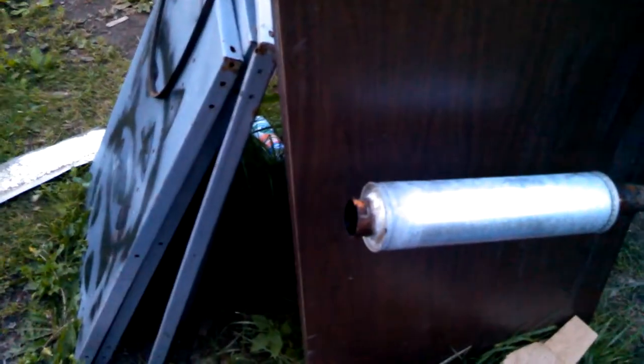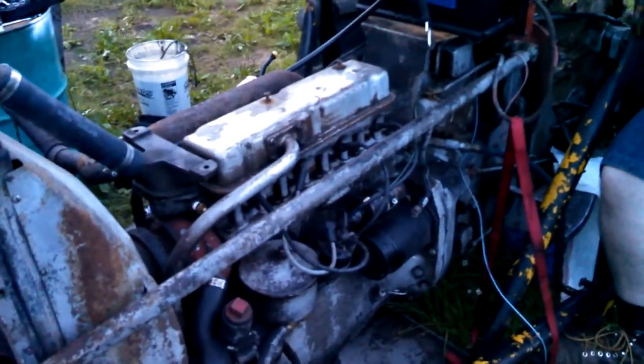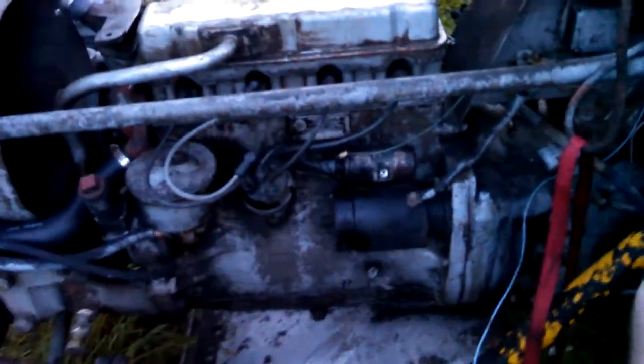The thing we don't like is there's a bit of a back rumble through the exhaust. It started doing that very noticeably once I leaned it out. I have a feeling it's possibly the exhaust valves. If anyone has any suggestions we'd be willing to listen. But part of us are thinking we may just run it at this point and continue moving forward, and come back to it if it becomes a problem.